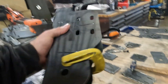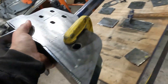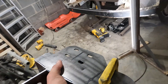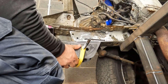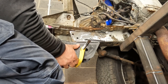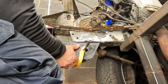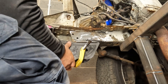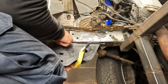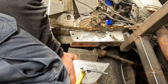This is the bracket all in one piece — suspension mounts through that hole. Time to check a little bit of fitment. So that's how it's designed to go. I've got a little more to trim out on this front piece here — that bit's in the way. But other than that, I'm feeling good about it. This piece is designed to be welded up there, with a seam run down there, and all these little slots in the bottom are designed to run. I'm pretty pleased with how that's looking.